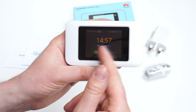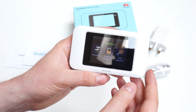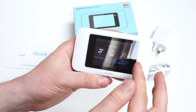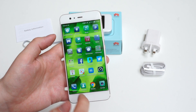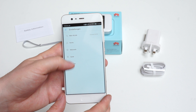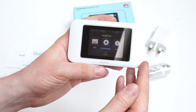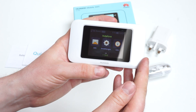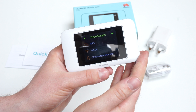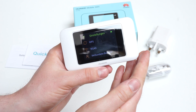The software is very fast and the display is responsive. The menu is simple and you can use it like a smartphone — no problems even for people not used to this type of device. Configuration is via touchscreen, browser web interface, or the Huawei Hi-Link app. In the software you can change connection settings and APN, set the device to 4G only, and adjust Wi-Fi settings including name and password. There is also an option for over-the-air firmware updates. The integrated Wi-Fi works on 2.4 or 5 GHz, supports AC Wi-Fi up to 768 Mbps, and you can connect a maximum of 10 devices at the same time.